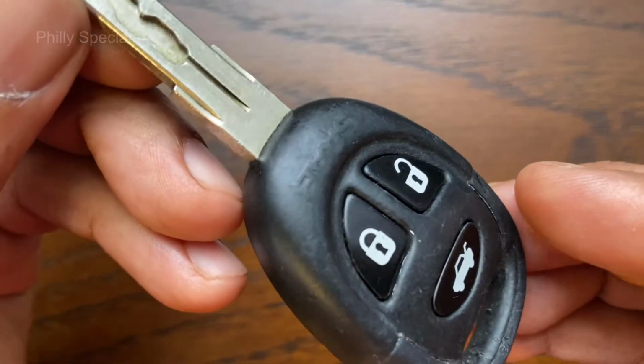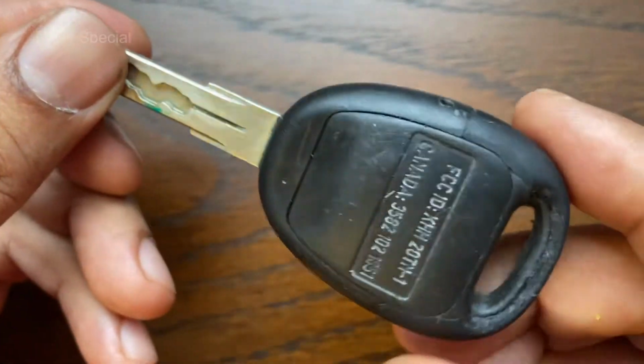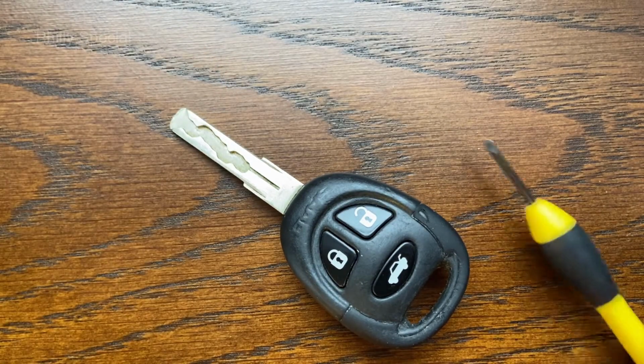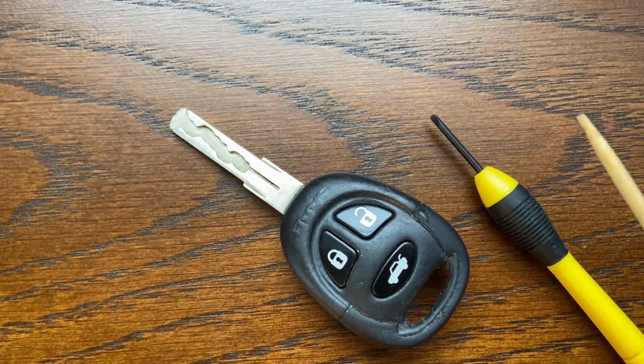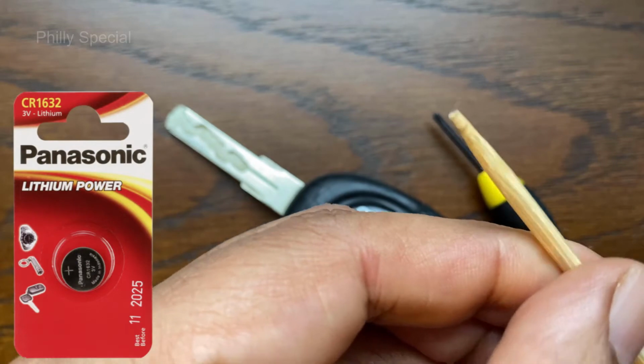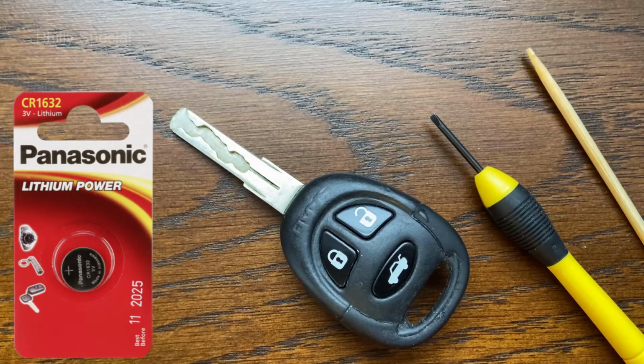In this video we will be replacing the battery from this Saab key fob. The only tools that are needed are a small flathead screwdriver and a toothpick. We will also need a CR1632 battery. I have included a link below for the battery.